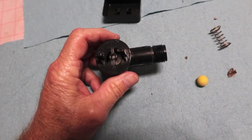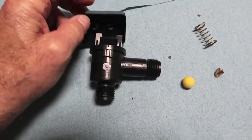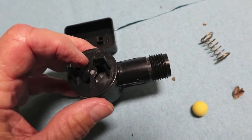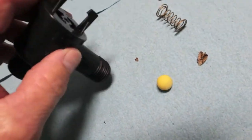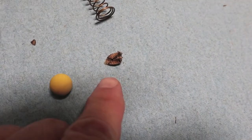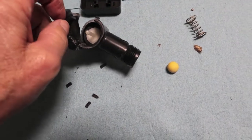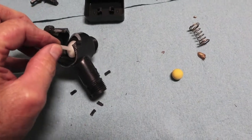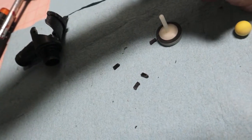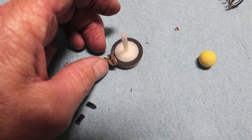On the OEM vacuum breaker I went ahead and popped off the top — it just took a little twist — and you can see where it is open to the outside environment and how a bug got in there. There's a little plunger; he blocked that valve from coming up and sealing off. He got into the discharge and that's why I was able to shake him out. You can see where he got mashed in there when the valve tried to close — it kind of pinched him. We did a butcher job prying it out and sure enough there's a soft black gasket right on top of the valve that lifts up and seals off. Our stink bug got in on top, which is open to the outside, trying to get some heat or water, and got pinched in there.